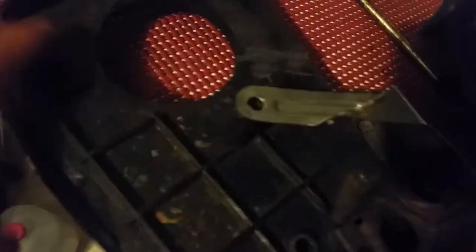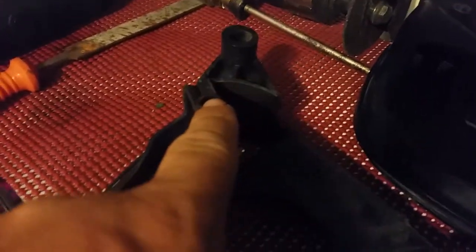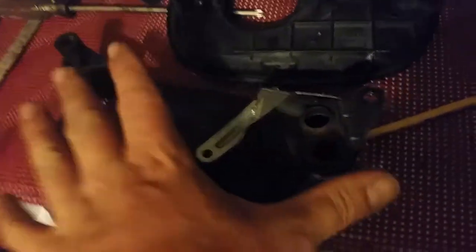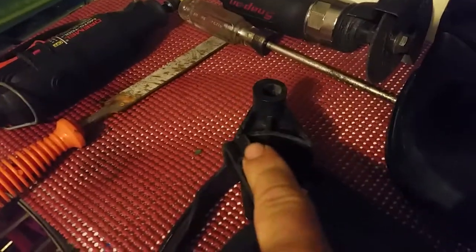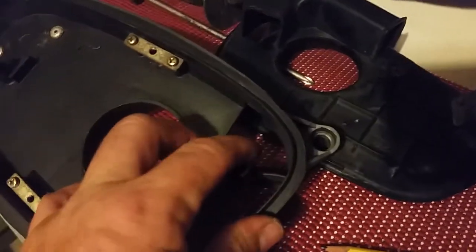On the back side, I cut off the tubes completely — the tubes are gone. I kept the mount for the air filter because you need the piece in the middle for your air filter screw to hold the whole thing together. You have two screws to hold the airbox together at the bottom and up top. If you cut that off you're going to be in trouble — it's just going to be floppy. So I left the whole structural part in place. It's strong — you can't even move it.